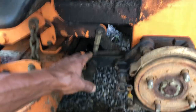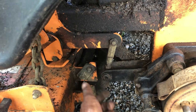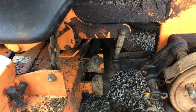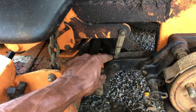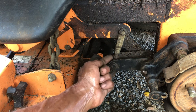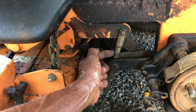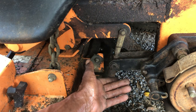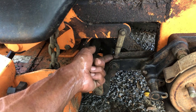We're gonna have to look at this piece. I see an adjustment screw in here - there's one on top and another screw on the bottom, so I'll see which one I have to take loose to get the result I'm trying to get. It doesn't look like there are threads on the top side of that nut, and I don't see threads on the bottom side below it either. Adjusting this nut downward probably won't work, and adjusting it upward doesn't look like it'll affect anything on the top side. If we need to pick that lever up, it's gonna have to do something with this bottom side, which will tighten up and lift that - that's where the gap came from that needs to be closed up.